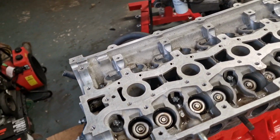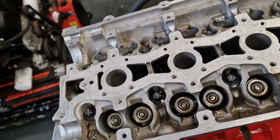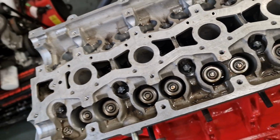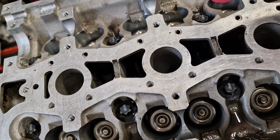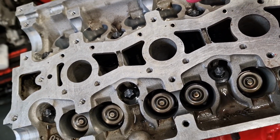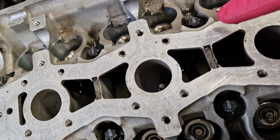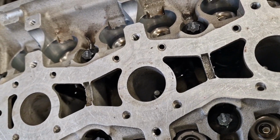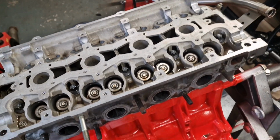Right, so I've just gone around another 20 Newton meters, just double checked they're all tight, which they were. I've marked the heads of the bolts, so we're now going to do the 2 180s. So we'll start again from this one, and at 180 will be, so that was down to like 6 o'clock, and then when we go round again, we'll finish up with that mark in that position you see it then. Right, so I'm just going to get you set up.